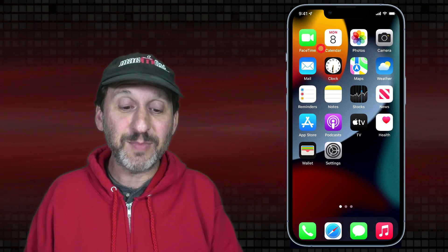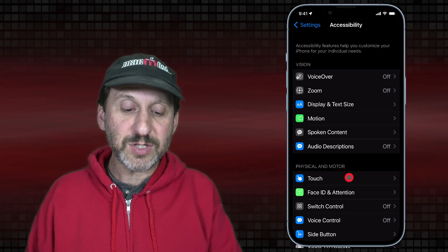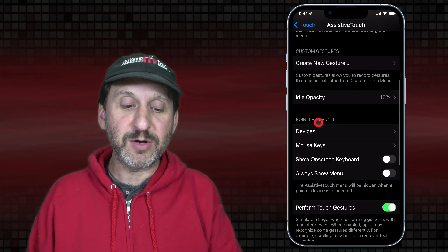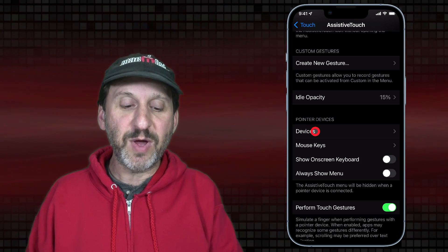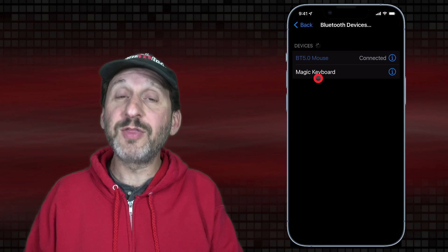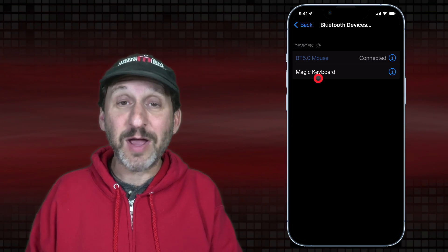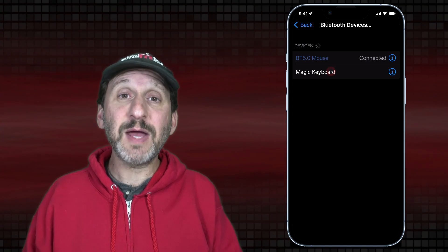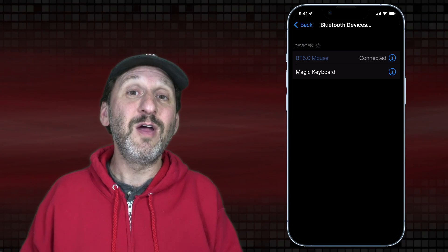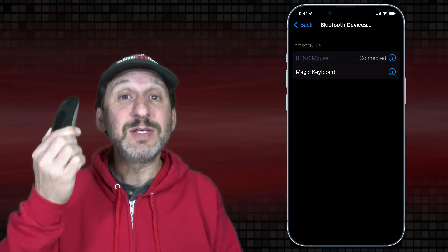Let me show you how to set this up. I already have it set up because you can see the circle there. If you go into Settings and then go to Accessibility, look for Touch. Here you have to have AssistiveTouch turned on — if you go in there's the switch. If you go down to the bottom you'll see Devices. Once you first turn that on nothing really happens, but if you go to Devices this is where you can connect your mouse. You can go into Bluetooth Devices and it will look for other Bluetooth devices. Sometimes when you connect a Bluetooth device it asks for a PIN — it's just four digits and you'll find it in the instruction booklet that came with your mouse. It's usually 0000 or 1111. For Apple mice, if you can get one to appear here, it's 0000.